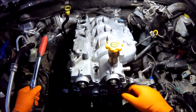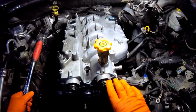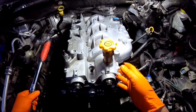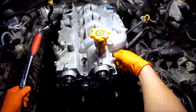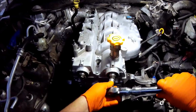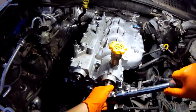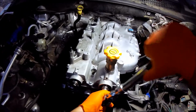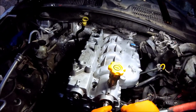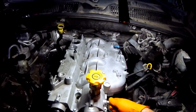All right, now that the cylinder cover is torqued down, I'm actually going to pull the service tool out and rotate this cam around to see if I've got all those rockers and lash adjusters in place, because if I knocked any one of them off, we're going to have binding here. So I'm going to remove this service tool. I'm going to rotate this. We should be able to feel all the valve springs, the resistance from the valve springs. Yep. Alright, that feels pretty good. There we go.